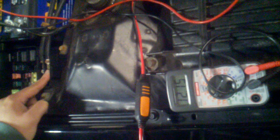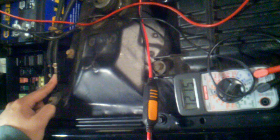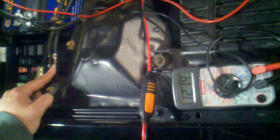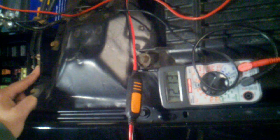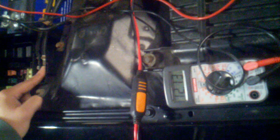If the car does start in the morning, then it seems like it's a faulty alternator. The weird part is it shows no current draw when you check it with a meter, unlike what you'd expect from an open relay or a short in the circuitry. As you can see, it's steadily dropping — it seems like it might be a bad alternator on this one. Hopefully this can help some of you with a similar mystery issue. Do the same test and see if it keeps dropping, because the alternator should not be sucking voltage from the battery — it should only be putting more power into it once the car is running.